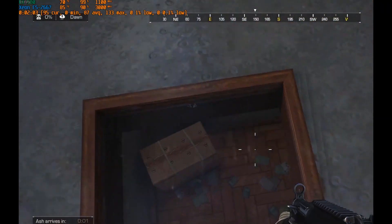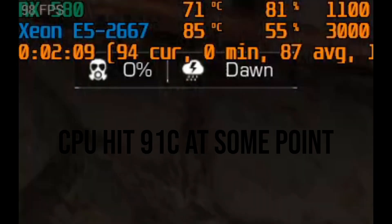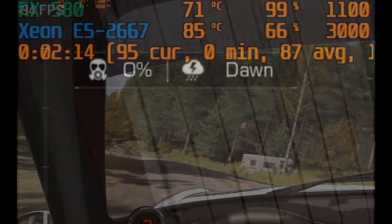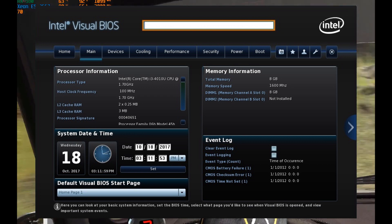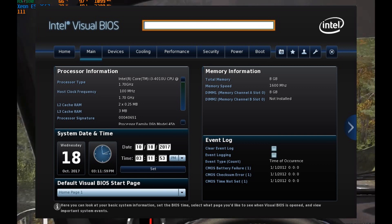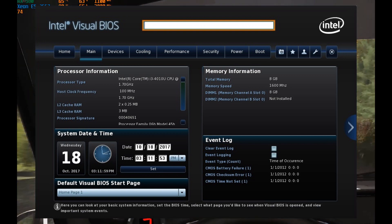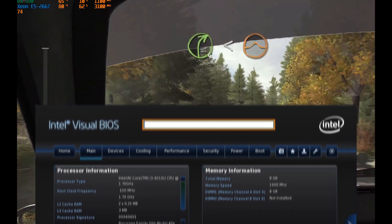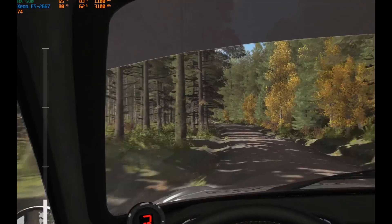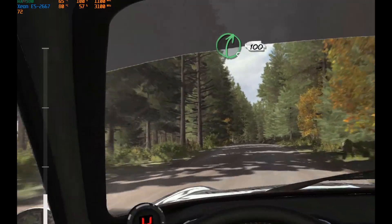Before I conclude, I should probably touch on a few things. You may have noticed the CPU and GPU were getting pretty toasty. The GPU just needs new thermal paste, but the CPU was struggling for sure. This is mainly due to the lack of proper fan control. This motherboard was made at a time when UEFI was in existence with features like fan tuning, but somehow Intel's more modern-looking UEFI never made it to their X79 boards. I haven't quite gotten the hang of SpeedFan yet, which is a fan control and tuning software, but when I do, temperatures should improve as the cooler I have should have no issue keeping this chip reasonably cool.